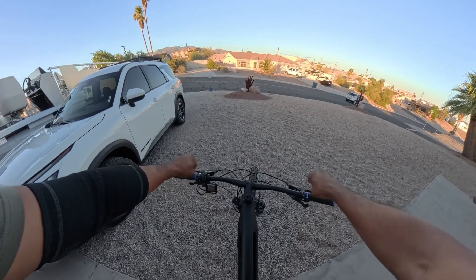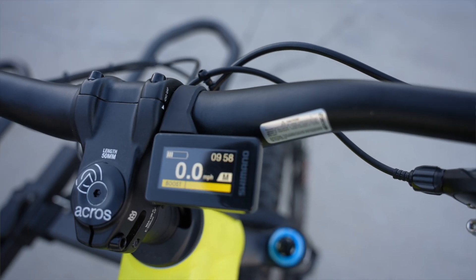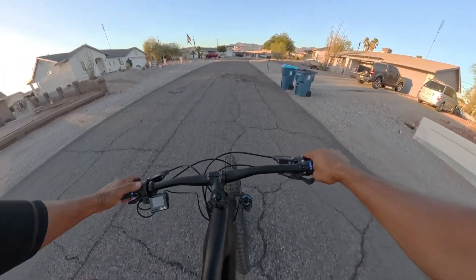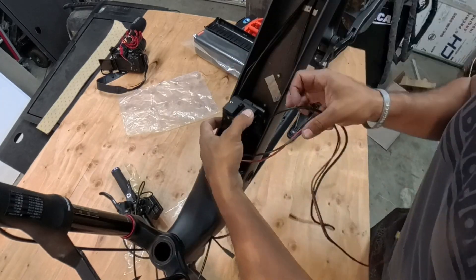The controller, though hard to see with polarized sunglasses, was actually much more intuitive. It had six modes, and you could feel a minute difference between all of them — very evenly distributed. Compare that to the Shimano controller with three modes — Eco, Trail, and Boost — or the Trek with four modes where the spread was more noticeable. With the Bafang you could dial in the modes very smoothly. It also had different power options and an additional wire on the harness — either to a throttle or a light — giving additional options the other motors simply don't have.